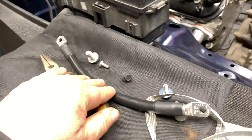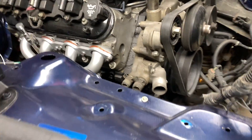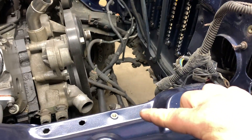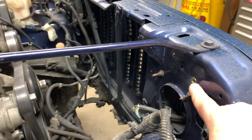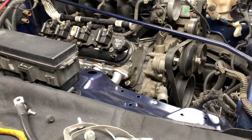We've got two grounds up there now. The next one I'm going to do is use this ground cable and come off the head to the nutsert, then use one of these from the riv nut to the one I put in the front — and that's going to complete the ground for that area.